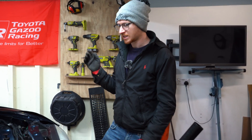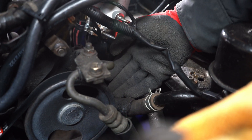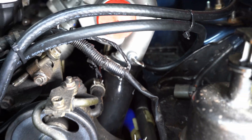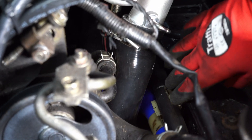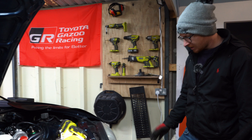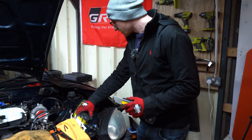So we've just clamped up the intercooler. I released the power steering clamps and rotated the power steering pump out of the way. You can see this pre-clocked turbo is actually slightly out, which is why we're pushed right over against this. I'm hoping that'll do for now and I can get it re-clocked later, because there is quite a nice gap where if it were just a couple of degrees this way it would line up really nicely. Also the intercooler pipes are quite close to the anti-roll bar, but I'm hoping that's not going to be too much of an issue — something I'll check when the car is back on the ground.